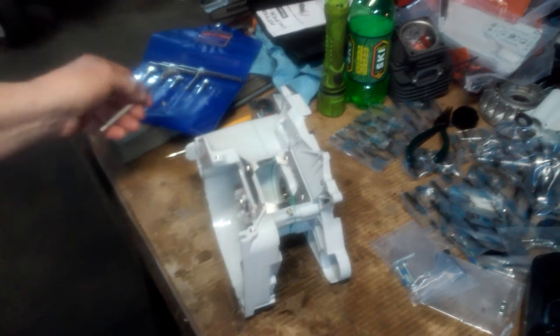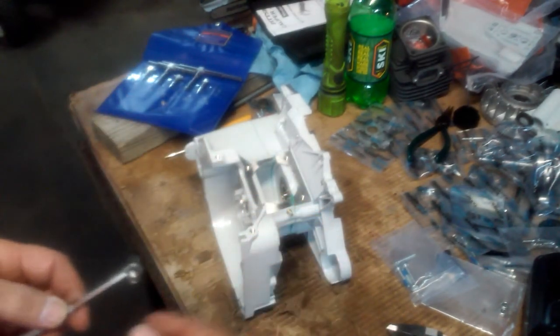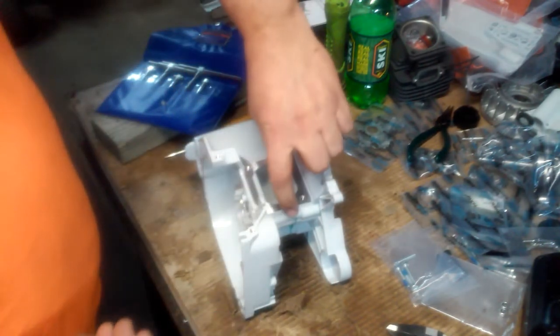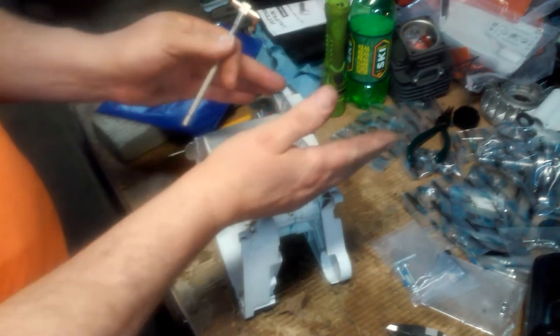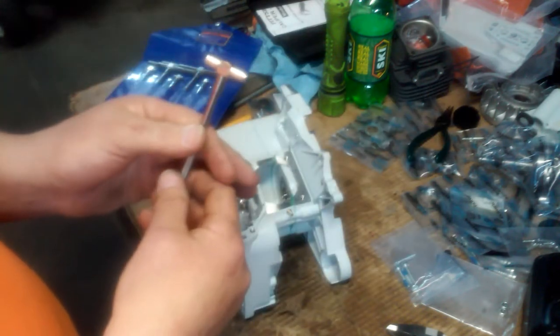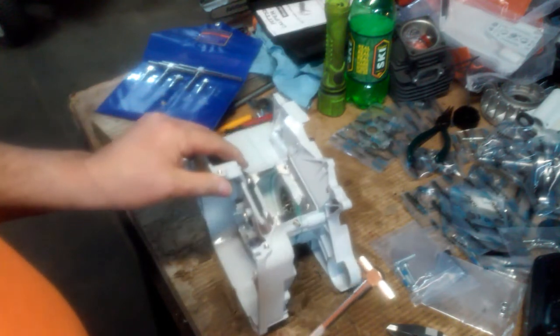So, front to back of the saw, the inner bearing race is almost perfectly square to each other, side to side, on both front and back. That means that our crank center line isn't going to be shifted to the front or the back on one side or the other, which could put lateral force on that side of the crankshaft and cause premature bearing failure or crank failure.